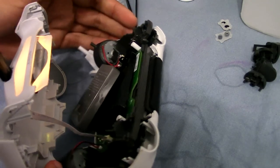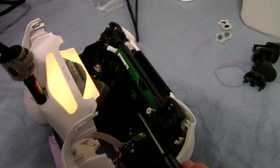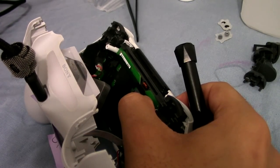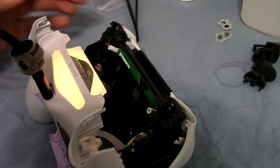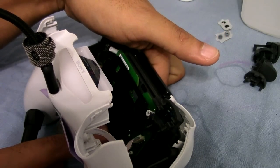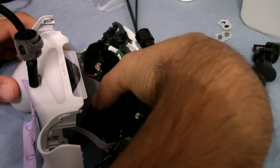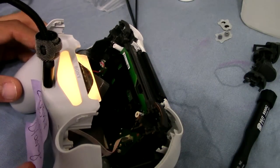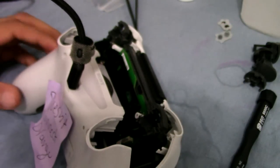What I want to do is actually try to reset the PS4 controller. You press this button right here — press it down and this should reset it. See how it turned off — hold it down for a few seconds and let it turn on again. Now let me try to reconnect it by pressing that button. And now it doesn't turn on. So there may be an issue with the USB port — oh, there it goes again and it goes away.